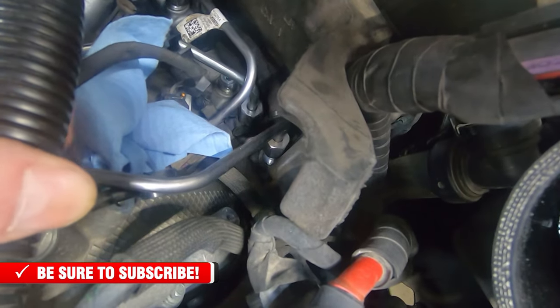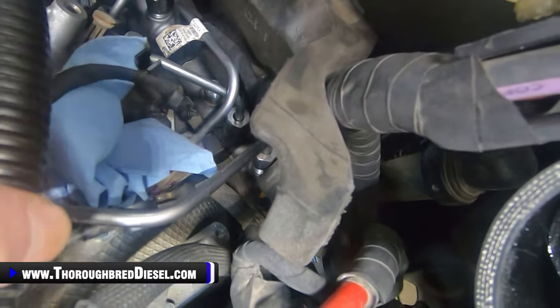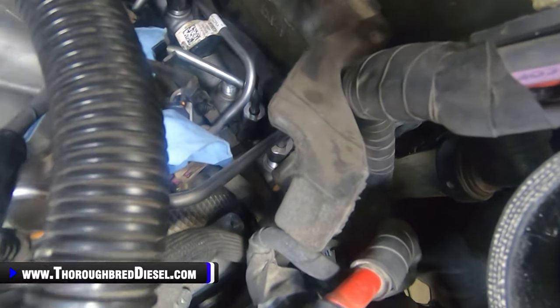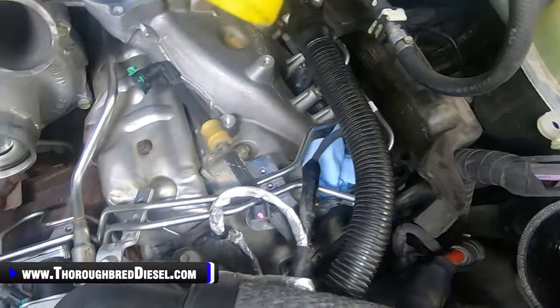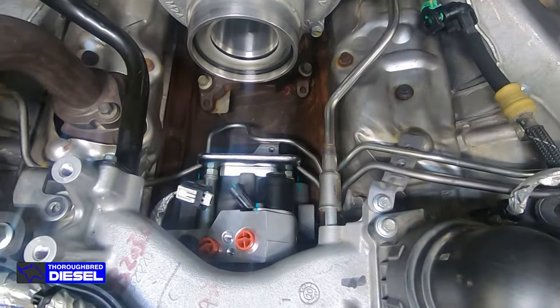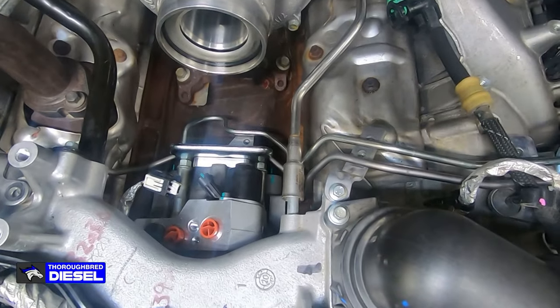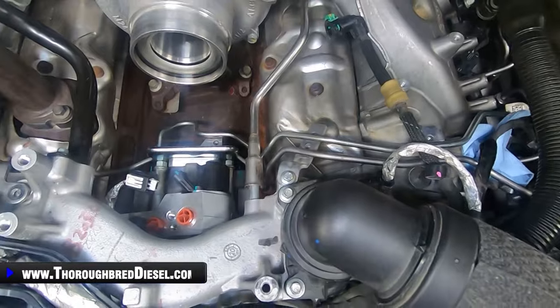That is the on the rail orifice that's closest to the engine. I'll show it right there. We can go ahead and attach it to the rail as well, because we're putting these on with crow's foot, so they're easy to get to there. So that is the routing of the passenger side line. Again, I like to start with this line because it is the line that goes underneath of our coolant line.